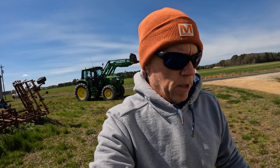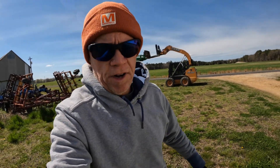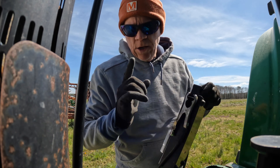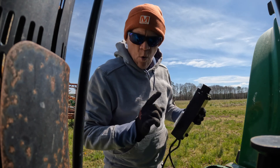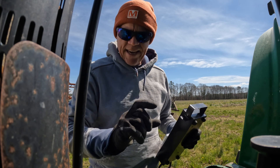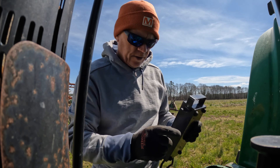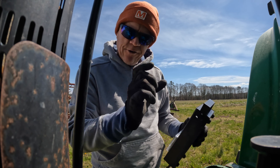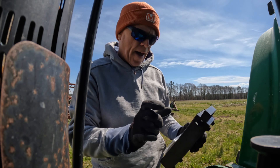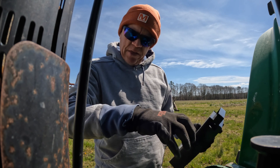Okay, it's up in the air but I can't get it to stay there, so while I'm working on it I'll just leave the skid steer in place. Okay, so I'm thinking I'm not getting a good ground on that starter, or I'm not getting a good connection on the positive wire. I'm going to do a load check — not on the battery itself, but on the connections on the battery.